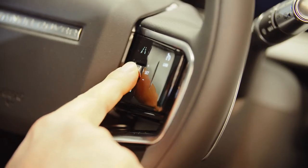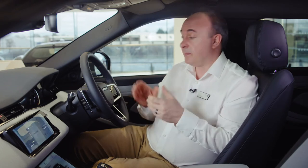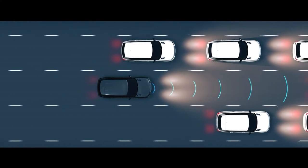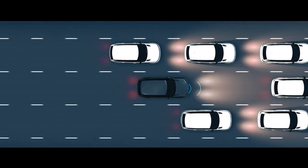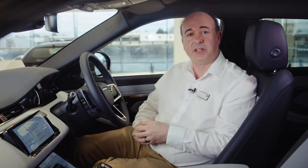On the right-hand side of the steering wheel are the controls for cruise control. Pressing Set while travelling at your desired speed and the car will automatically maintain that speed until you touch the brakes or press Cancel. Pressing the accelerator will cause the car to speed up, but when you release it, it'll return to the set speed. Pressing plus or minus will increase or decrease the set speed. If cruise control has been cancelled, simply pressing Resume will return the car to its last set speed. If your car has adaptive cruise control, a radar monitors the speed of the car in front. If they're travelling slower, the car will automatically match their speed, and the buttons on the left and right will increase and decrease the distance between you and the car in front. Whilst you need to be travelling over 20 miles an hour to activate cruise control, adaptive cruise will match the speed of the car in front all the way down to zero. If traffic restarts within three seconds, your car will pull away with the traffic — any longer than that and you just need to give the car permission to go with a gentle press on the accelerator. This function means that adaptive cruise control can be used in tiring stop-start traffic situations.